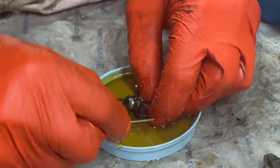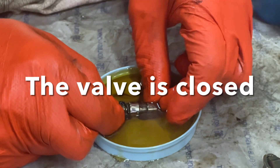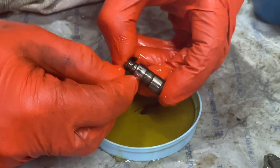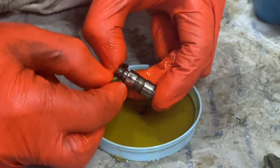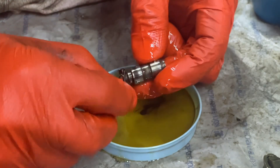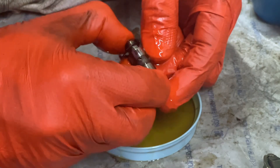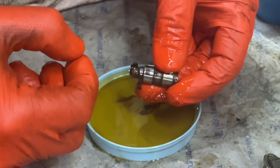Now if I remove the drill bit, and then try and push this - it has gone solid. And this is exactly what the lifter is supposed to do. So now I'm cleaning this up, sticking it on the shelf, and then I'll come back in an hour or so to see if it's still stiff. And if it is, then I know my lifter is good.